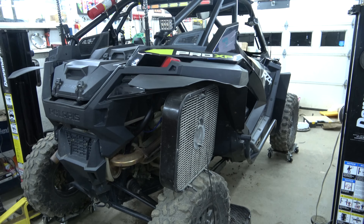I'm going to fix the shroud with the three back velcro strips and use one screw with a washer — there's a little clip that goes behind here and grabs onto the fender. Not too bad. Front shroud time — the hardware includes two nuts, two washers, two screws, and two weird-looking clamp things with a hook on one side. Get it lined up and bolted down — just finger-tightening for now because we're going to need to do some adjusting.